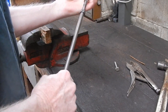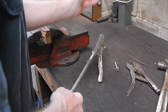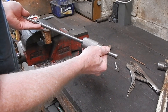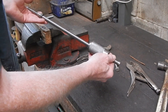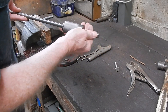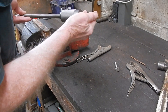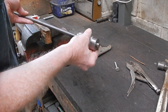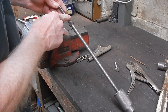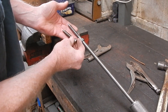What's involved? Not much at all really. All it is is a shaft — that could be out of a plain piece of steel that you've reduced, or you can use a shaft of a smaller diameter than the end and weld a nut on the end to stop the hammer slide from coming off, because that's where all the force is going. You can either weld on a nut, machine it out of one piece, or put a thread on the end and screw on a nut. All you need is something to stop that slide coming off. Up here, all you do is put a threaded section on the shaft with an adjusting tip on it to emulate the screw.